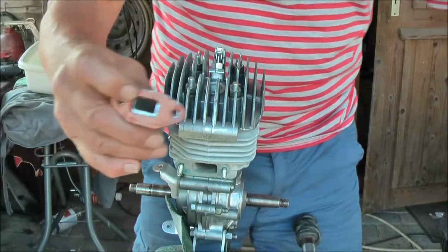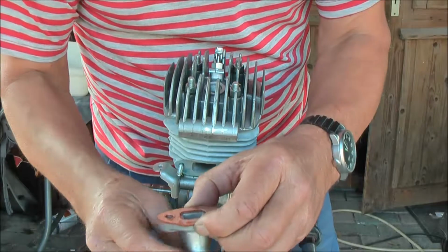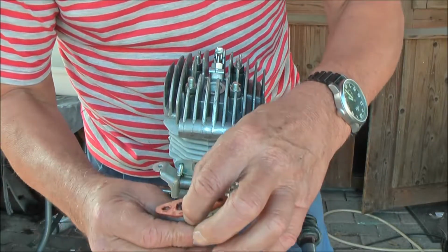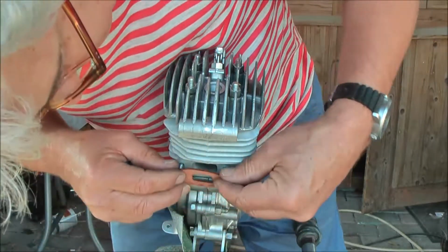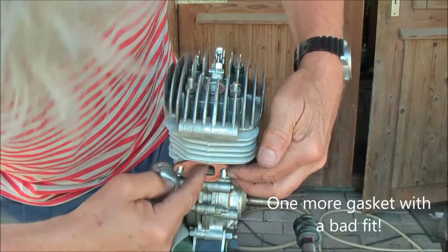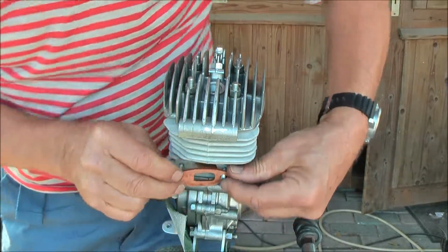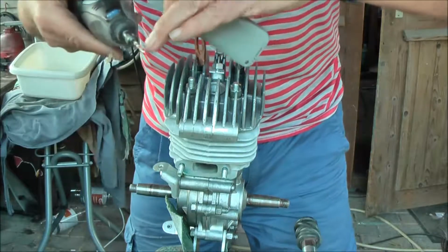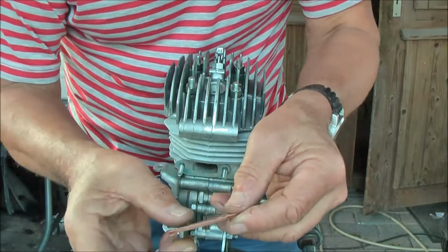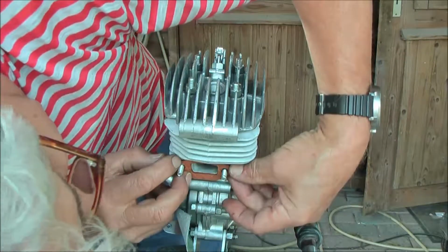The cylinder, look, the joint is more than large enough for this part, but it partially blocks the intake for the piston, and I don't like that, so I will make this a little bit larger. The lower, that's all okay, but it's the width that's the problem. Using this tool on the Dremel, I'll put some grease on the joint. I wiped off the excess, and we can now slip it on. Check if this is the right, yeah, okay.